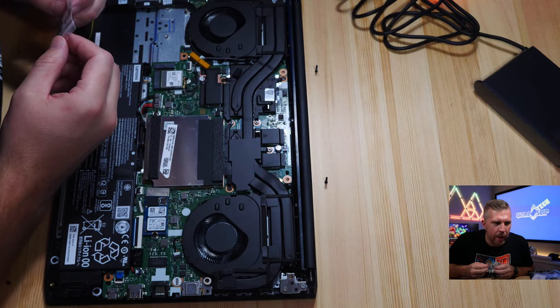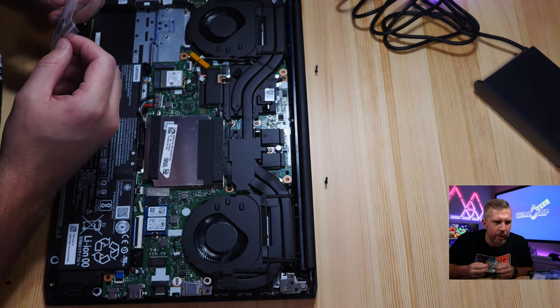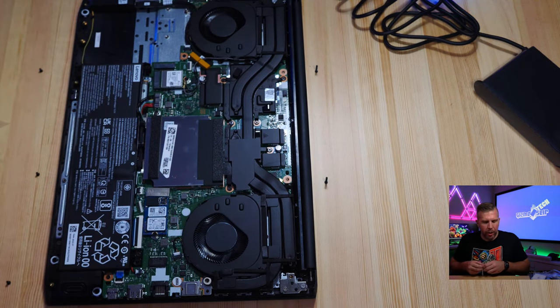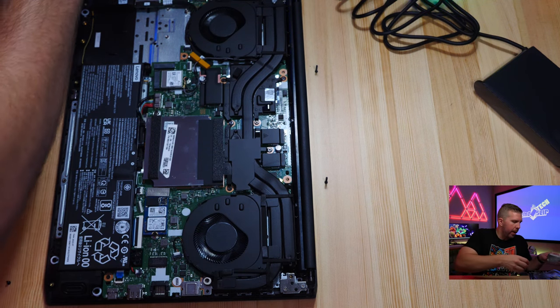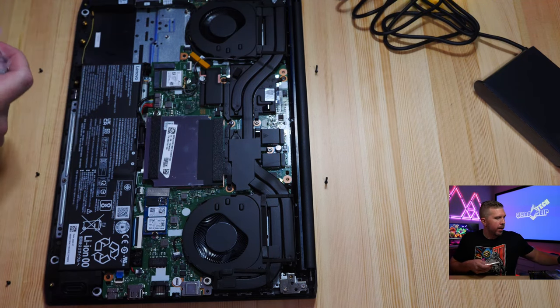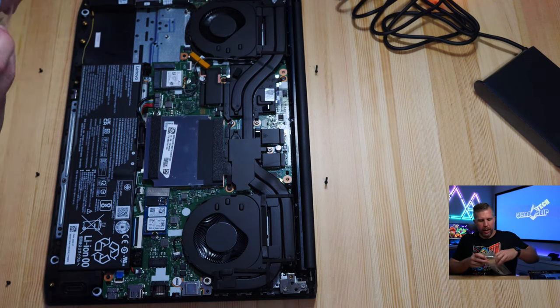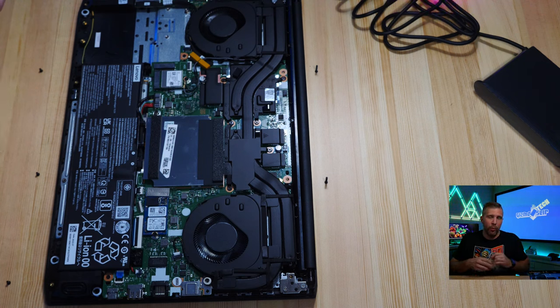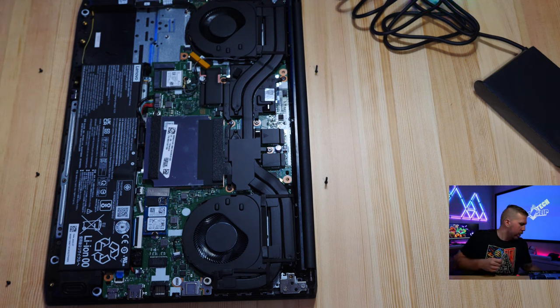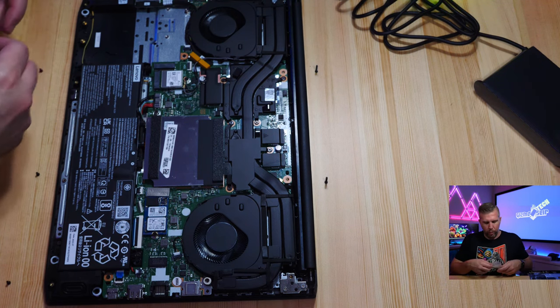Do you think if I buy better RAM memory on a laptop, it will give me any better performance? I know some 3200 is CL22, doesn't matter much. You probably won't get much additional performance, except in certain memory-sensitive games. If you're playing a very memory-sensitive game like CSGO or Shadow of the Tomb Raider, maybe Hitman 3, you'll probably see up to like a 5 or 10% performance improvement in those games. But in very GPU-bound games, you probably won't see any kind of memory performance increase.